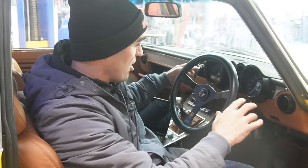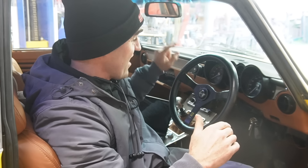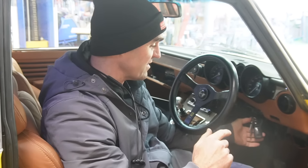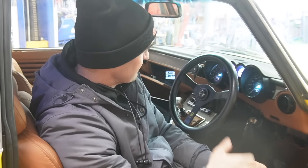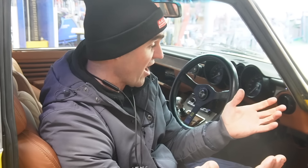A lot of the work I've been doing in the background has been little tedious things, like doing more work on the gauges. I've mentioned I'm not entirely happy with the Speedo and Taco — I'll probably change them out at some stage, but they're currently working. The other gauges — oil pressure, oil level, fuel level, and water temp — are all Raceworks gauges. The two oil gauges were working, but a lot of you commented on this. If I turn the ignition on, you can hear this beeping going on — that is the Raceworks gauges in alarm, telling you they are out of spec and giving inaccurate readings.